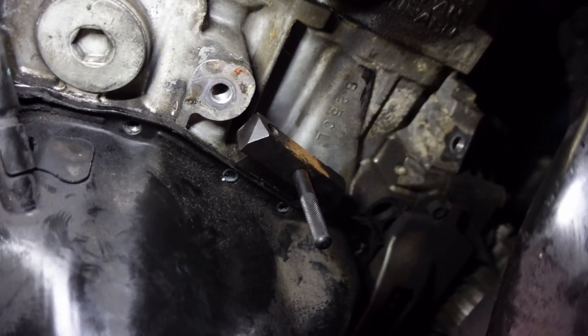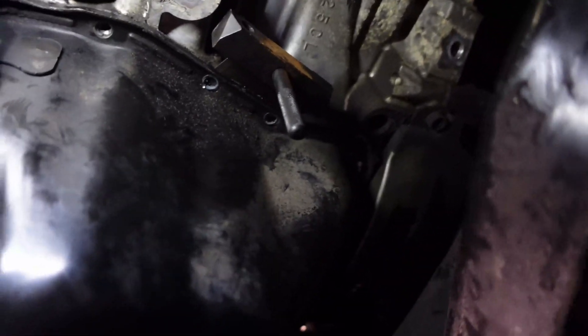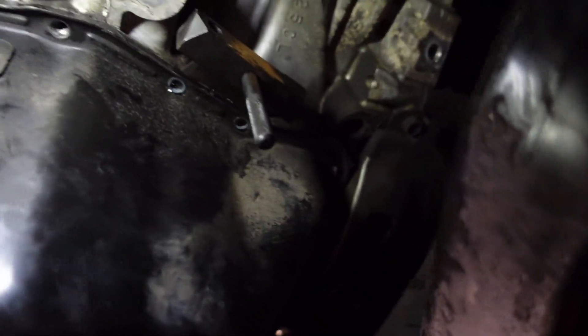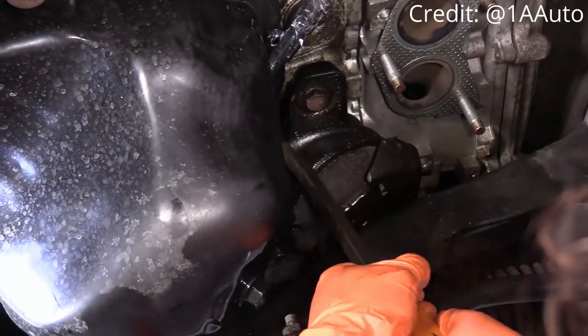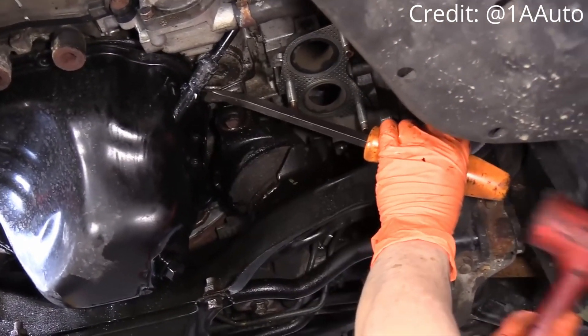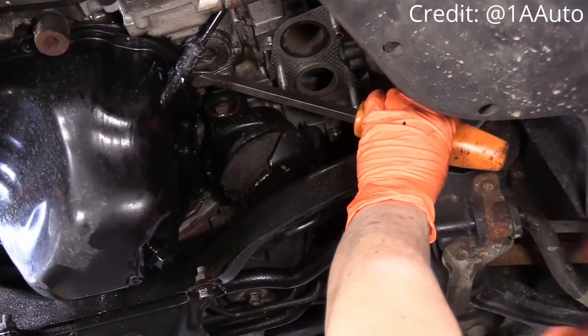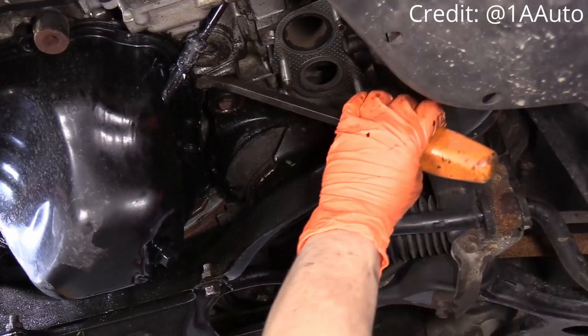I was hoping I didn't have to do it, but honestly, with the engine mounts in and the exhaust in, there's just absolutely no space to get any sort of tool in between the oil pan and the block. I've seen a lot of videos where people use pry bars, but they also say don't do that because you can easily bend the oil pan — and if you do and try to put it back, that's a leak — or you can scratch your aluminum block.